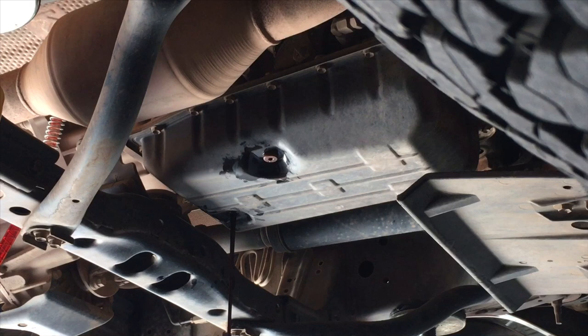This is always going to be a kind of 90% thing — you're never going to get all the oil out. You could put a hundred litres through a transmission and you're only going to get 99% out. 90% is good enough. 70% is good enough. Rather than put 30 or 40 litres through every five years, I'd suggest you do it more often using less oil. Doing it every 50,000km is probably too often — wasting oil and paying unnecessary labour. I would suggest about the 100,000km mark.